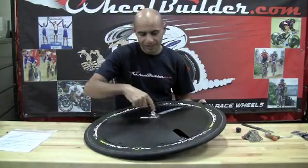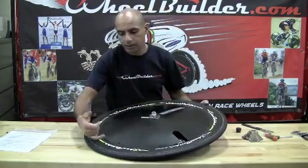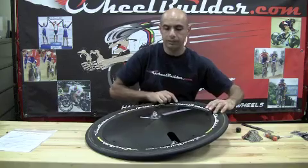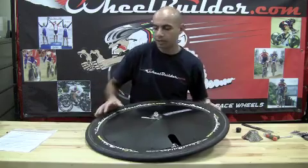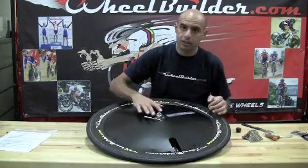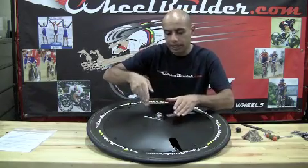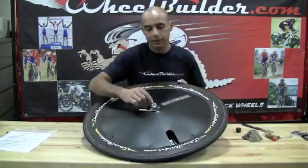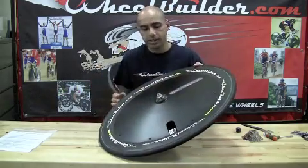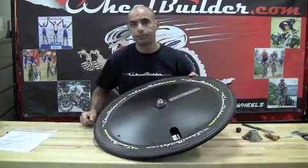What I've done here is interrupt the contact at the center of the hub with this rod to demonstrate that there's quite a bit of warpage on this cover — the cover is lifting up from the rim between fasteners, has quite a bit of wave to it, and is buckled at the valve stem pocket. If you are having these types of problems with severe warpage, chances are it's because the center hole in the cover does not have a large enough clearance to allow the hub to poke through. It's a relatively simple problem to solve: you can file or lightly sand the center hole until the diameter is opened up enough. The key is to not have the cover being held up by the center at the hub.